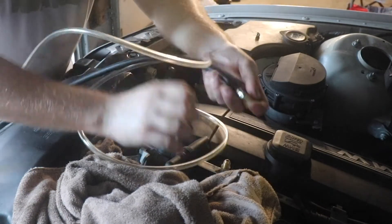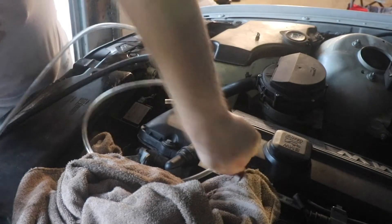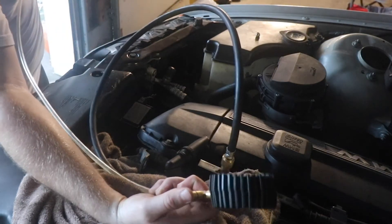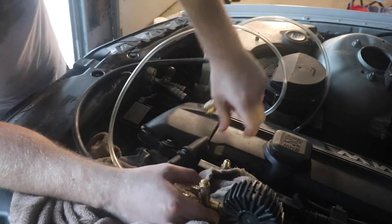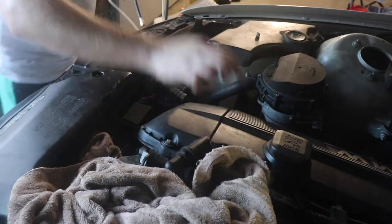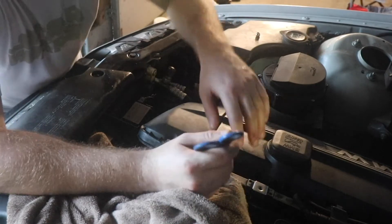Using the Ford adapter, I'm going to screw this in. Technically I could read some fuel pressure if there was any, but I'm just going to press this little valve here. I think we're good — I don't think we have any fuel pressure. I'm going to press the little valve in here with some scissors just to make sure we got it all. We're good, we have no fuel pressure in there.